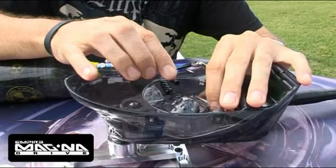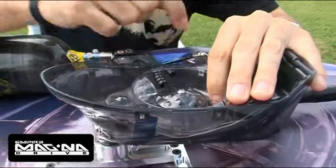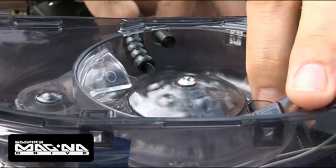The first thing we're going to take a look at is the actual clutch system. What you'll see here is even if I stop the paddle, the drive is still rotating. So the agitating surface is still moving but the paddle isn't, and what happens is the clutch is just slipping as it drives around.